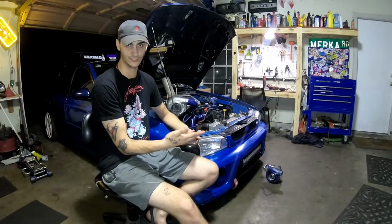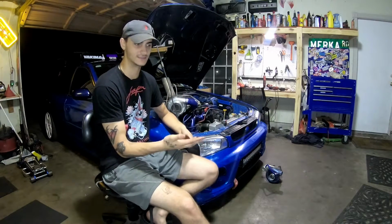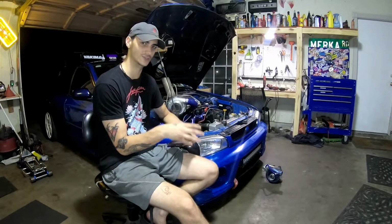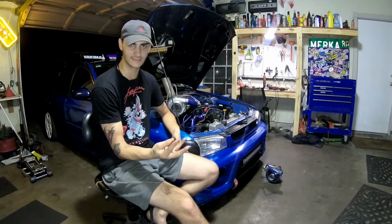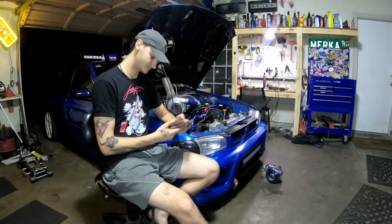If you do go with bigger injectors, you're going to have to get it tuned, and they don't have any tuning software for the stock ECU, so that's why you have to find a piggyback system or just go full standalone, which is what everybody pretty much does now.